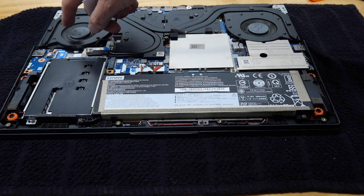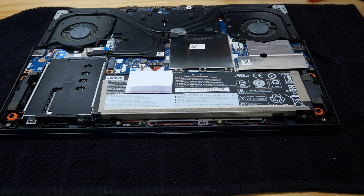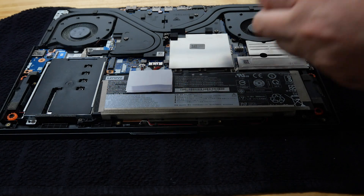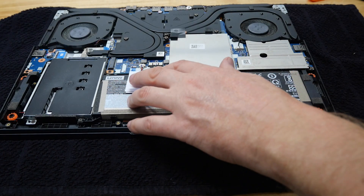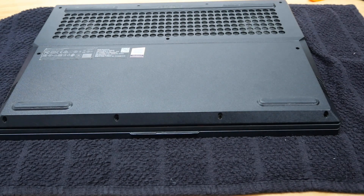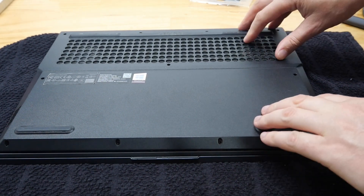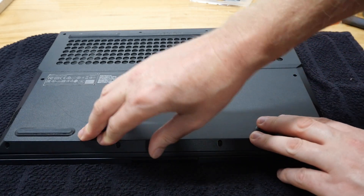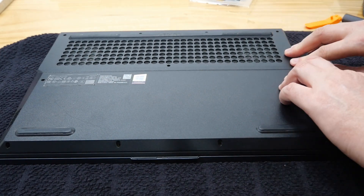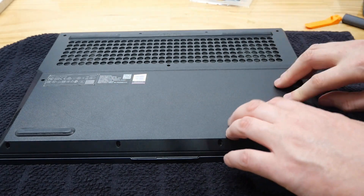Don't put all the screws back straight away — just clip the back on, flip it over, and try it out to see if you've solved the problem. If not, unpry it again and try a different amount of paper. While you've got your laptop open it's also a good chance to give it a clean — clean your fans and get the dust out. When you've got your piece of paper set in position, put your cover back on carefully. Make sure the paper isn't touching anything electrical — you don't want to start a fire inside your laptop — then clip it all back in position.